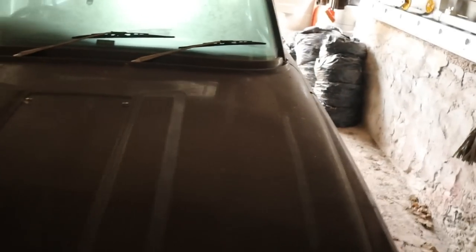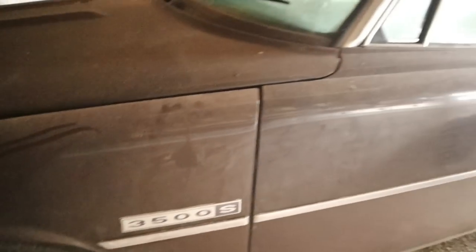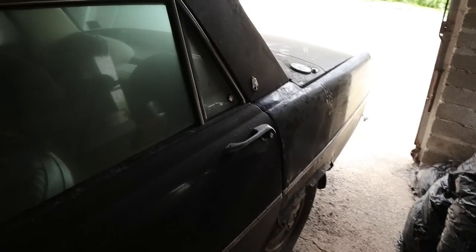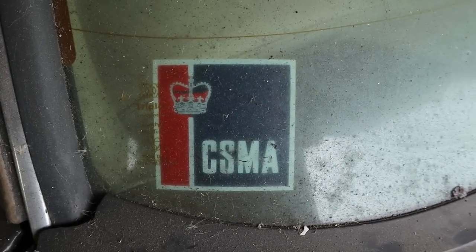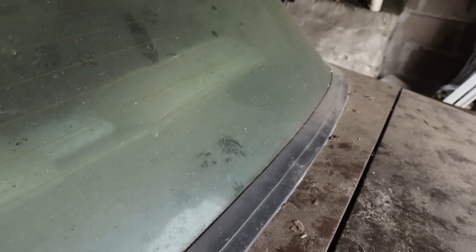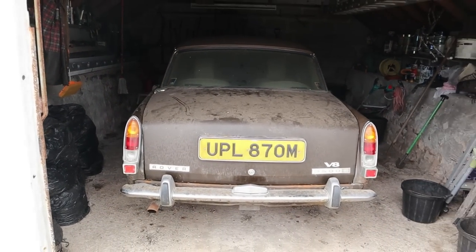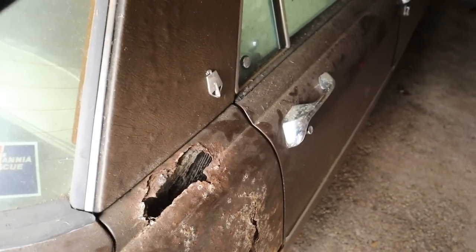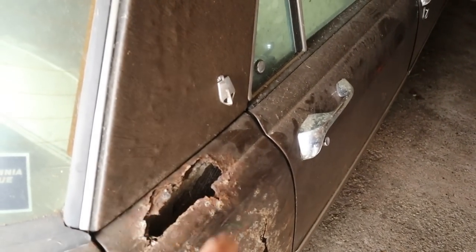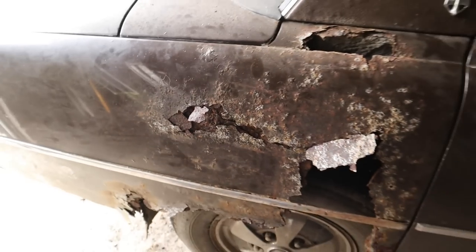You can see little paw prints where the cat's been on the car — they've got an absolutely beautiful cat, I'll try and get a shot of it for all you cat lovers on the channel. The sills and stuff are pretty intact; it's just the rear half of the car that's rotten. Because it was parked in the same way, water has dripped on the back of the car and rotted the rear arches out. The rear deco-panel rubber's in really good condition, which is good. The rear chrome's not too good. The water has obviously been dripping on this side really badly and rotted this wing out. You can see the amount of rust — it's not good.